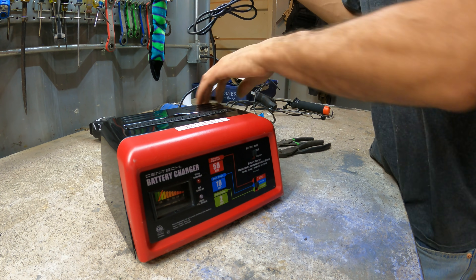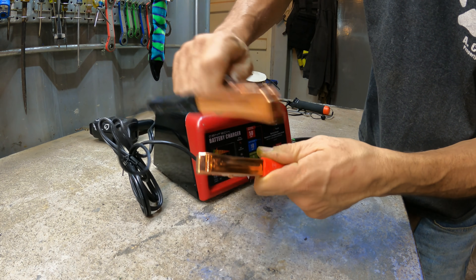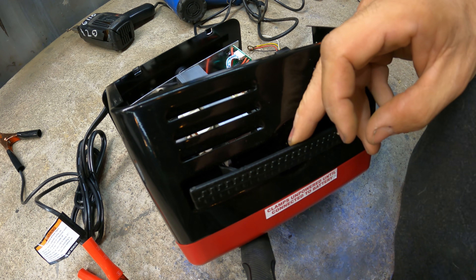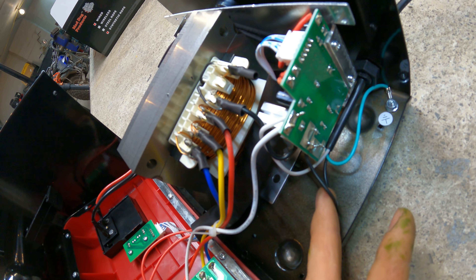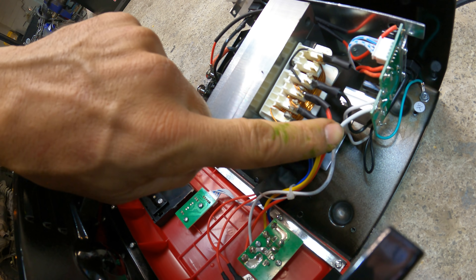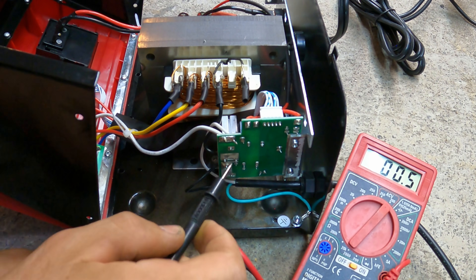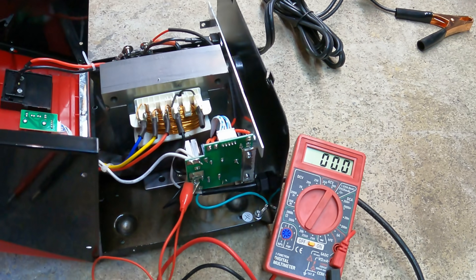One more quick electrical project here. So this thing - brand new. You plug it in and nothing. There's this sticker here - says 'clamps unpowered' - no, we're not doing that, this is going to be all-the-time powered. Here's our power coming in - ground to ground, black is our hot going to the circuit board, and white also goes to the circuit board. Here is the transformer, so you can see the three different amperages coming out of it. Turn it on - there's our power coming in, confirmed. Right here, this is what turns this on - once this black wire gets energized, this thing is on.